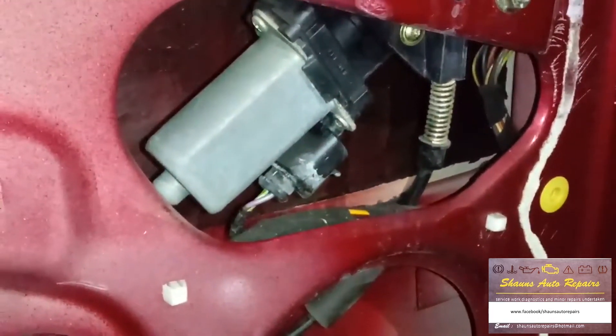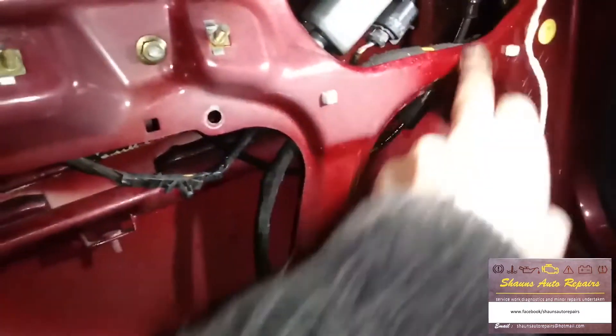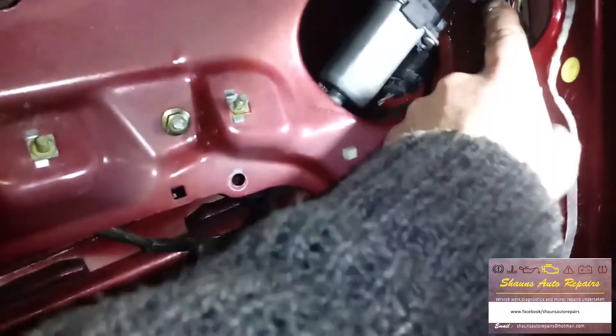You can see the mechanism is trying to move but something is seized up, so we need to investigate that further. What I found was the problem is in this cable here - it's like a bicycle cable, it runs on a track and goes all the way around. It literally pulls the window up and down a track. The cable was going tight or seized at the bottom, where it goes from the motor and round up to a joint underneath. You can see the rail up inside.